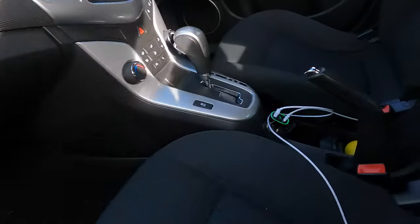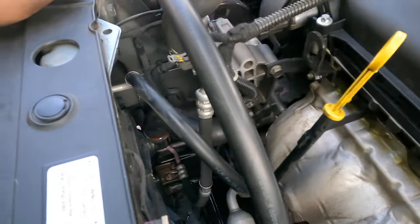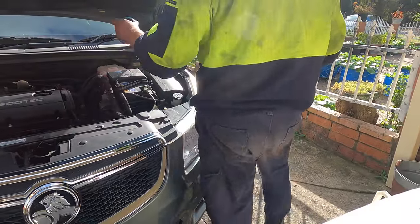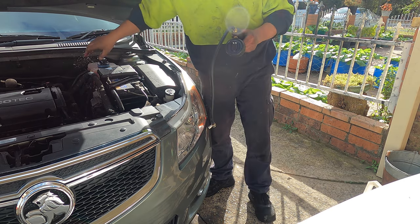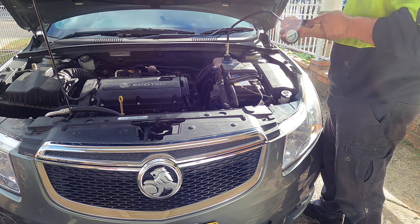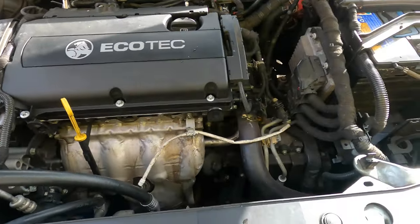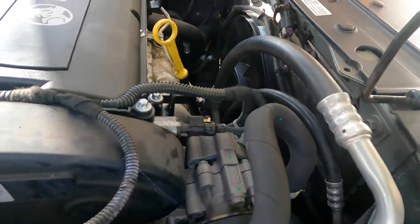We check the water level all over again. We've got the new water pump and checking it - should be cooking good now. For everyone who needs the tools, you can buy them on eBay. Every time you drain the water, there is a lot of air and bubbles inside. You need this tool to pump and push the water down - push it into the water pump so it circulates. Make sure it's pushed in and you can see some pressure building up.